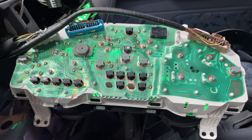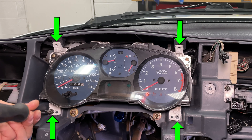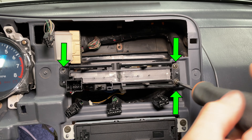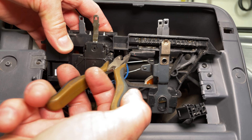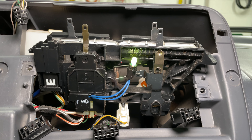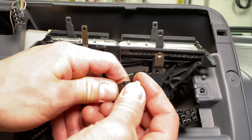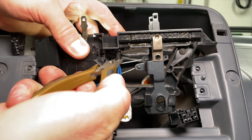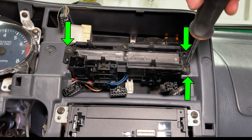Make sure all four light up. Now the dashboard is ready to go back in — reinstall the four Phillips head screws that hold it in place. The climate control is held on by three screws. Pull it out and tip it up. Wiggle the light bulb socket with the blue wires with small pliers to remove it. This is also an incandescent light with a green cover. Pull the light bulb out and replace it with the LED. If the LED doesn't turn on, turn it 180 degrees and plug it in. The light socket just snaps into the climate control — you don't need to turn it. Reinstall three screws into the climate control.